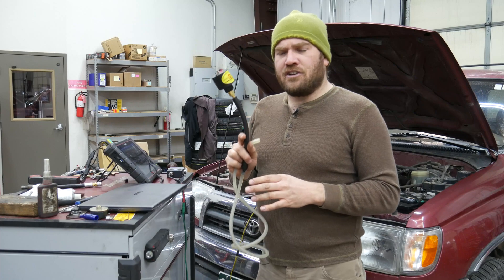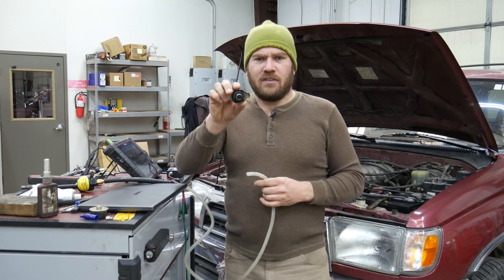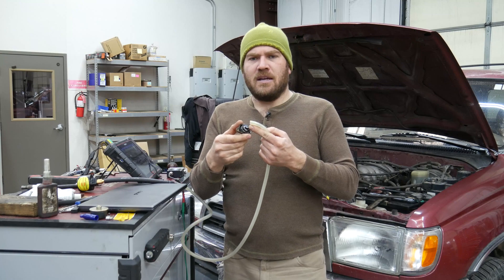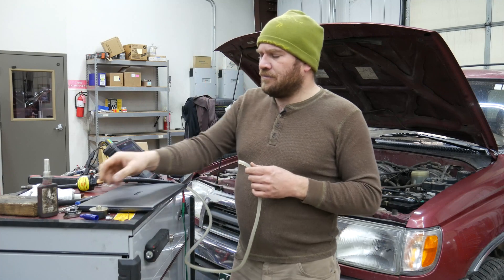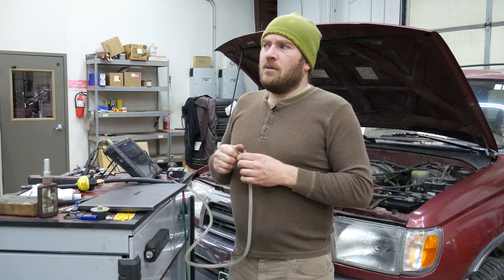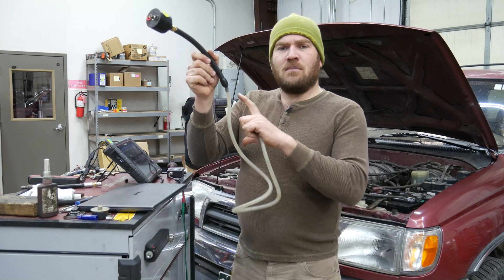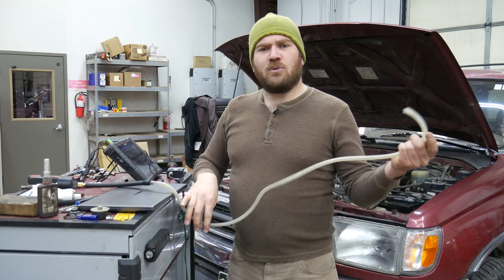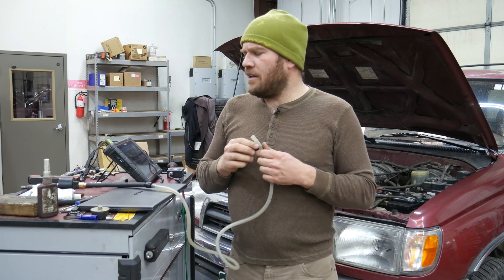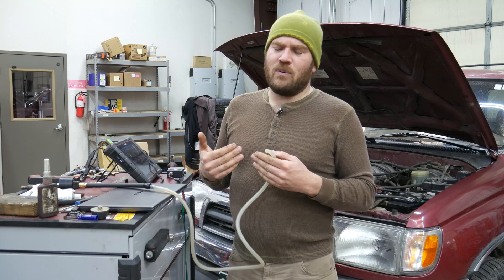Also, don't let this sit on the engine as you're running it because you're going to get weird waveforms. I have a radiator cap — this is the one I took off the vehicle. I have another one that has the little center button broken off of it, so it works perfectly for letting me hook up to the radiator overflow neck and I'll still get all my pulses. Some guys use their pressure gauge setup with an adapter cap. Some guys will use a little air chamber in their line so they don't get coolant into their gauge. If you can drop the coolant level a little bit that helps, but the more you drop it the less movement we're going to see in our pulses because we're going to have more air volume. Liquids don't compress, air does, so it'll dampen it a little bit.